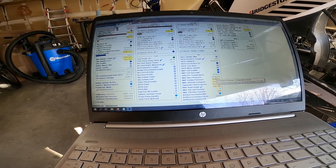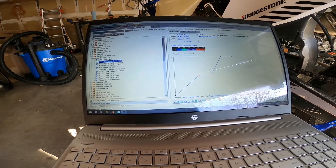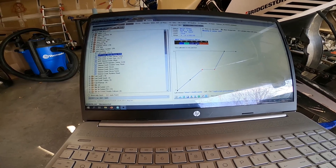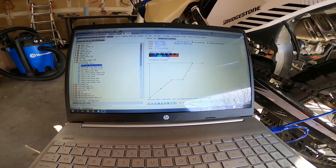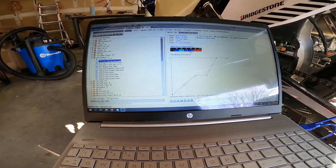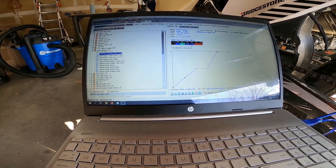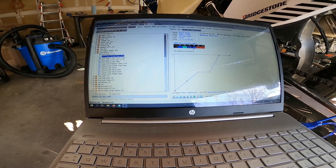I'm at 80.8 for my barometric pressure, so I'm right between these ranges. I'm almost thinking that's dropping my AFR even more — like this table is set up maybe backwards. It might just be the way the logic in the ECU works. But it feels a little backwards to me to go negative on the AFR and actually enrich things as your elevation is increasing. I feel like you should be leaning out a little bit.